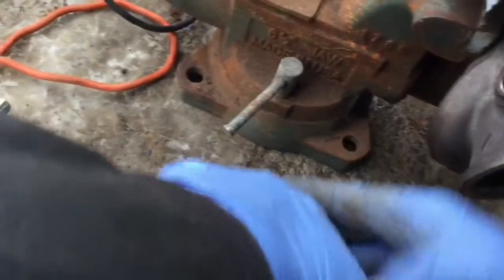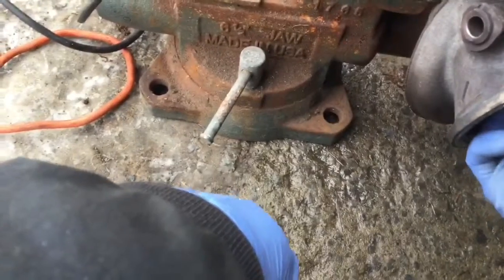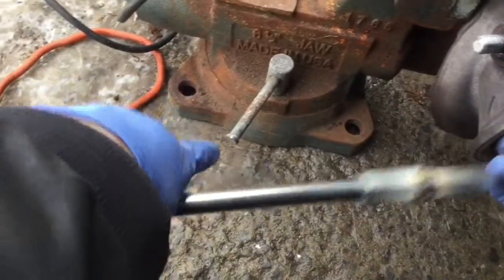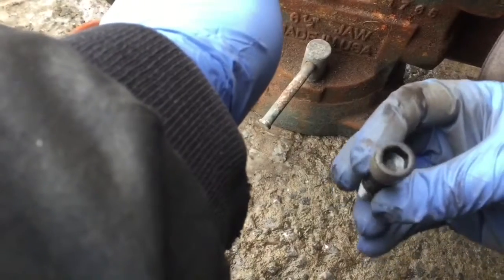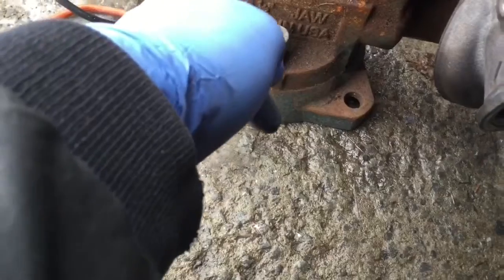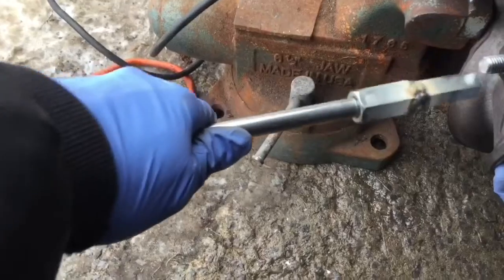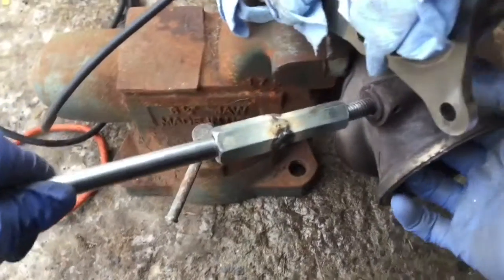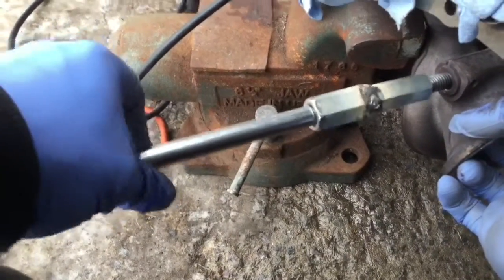So same process, we use the hammer puller. We use a bolt that we're going to slide from inside the bushing here. So the bolt is in. Just screw the bolt. It's just a regular cap screw that's just been ground a bit to make sure it's not going to damage the inside of the surface where the bushing slides in, this thing here, the exhaust part.